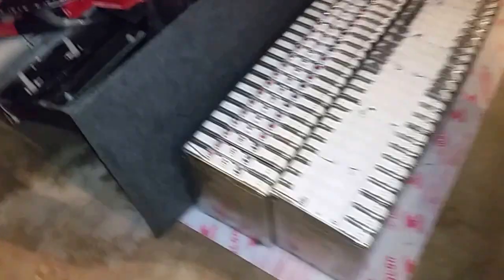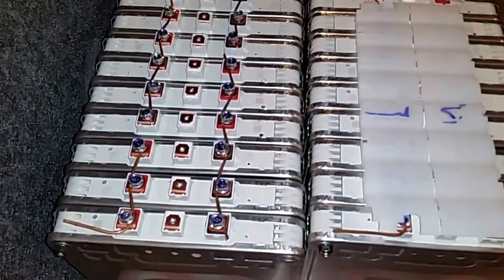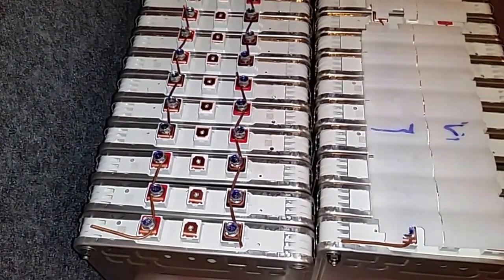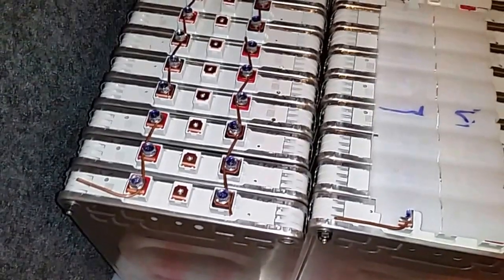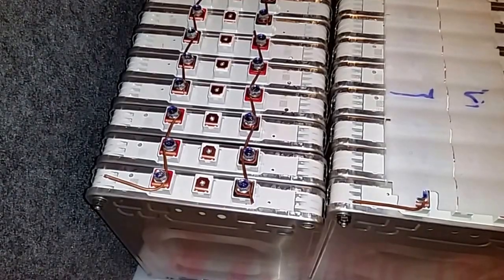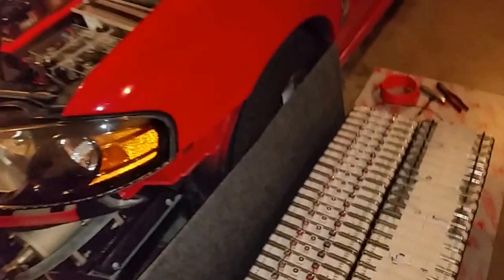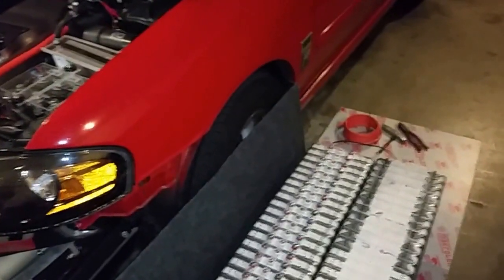What I'm going to do now is connect them through the car charger and charge them, and see how many ampere hours they can take. That will give me a very good idea of how good or bad these cells are. If I take a multimeter between the two terminals, I see 126 volts. So I'm going to charge them to 132.5 volts, which is the charge voltage I use for this car and other similar batteries. Then I'll compare the ampere hours being put in.